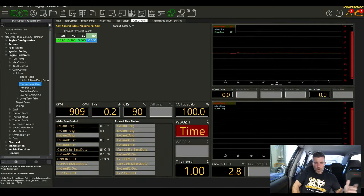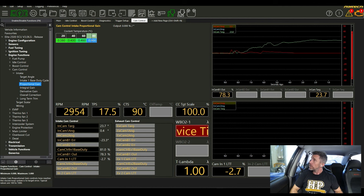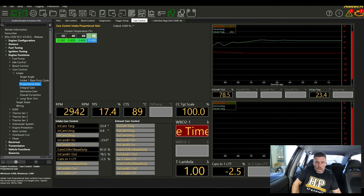With the proportional gain, we don't have fixed universal numbers — this varies between ECUs. At 3000 RPM on the dyno with zero proportional gain we have no closed-loop control, so our cam target has jumped to about 23 degrees but our actual cam timing sits at zero. Starting with a proportional gain value of 0.1, we see a really slow, lethargic rise up towards our target on the graph — it's doing the job but far too slowly. Cam control needs to be quite quick.